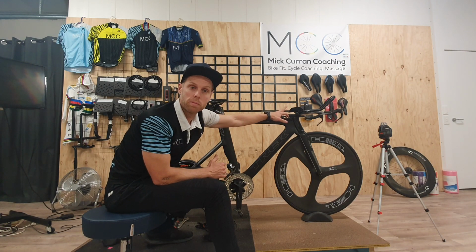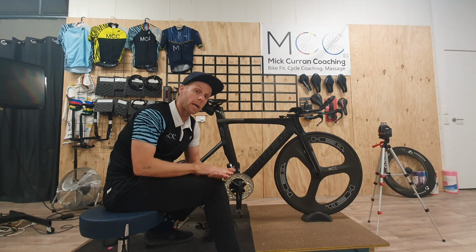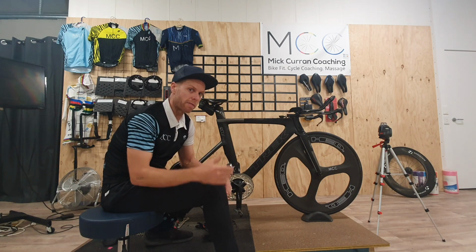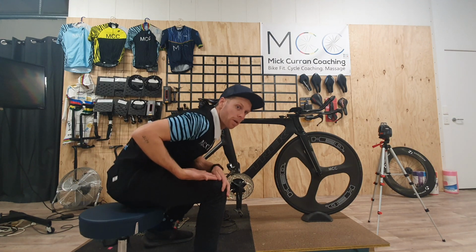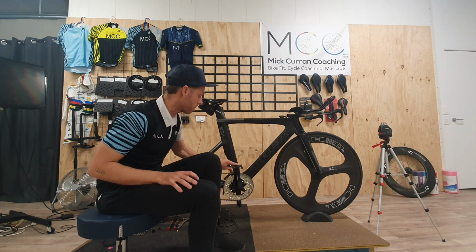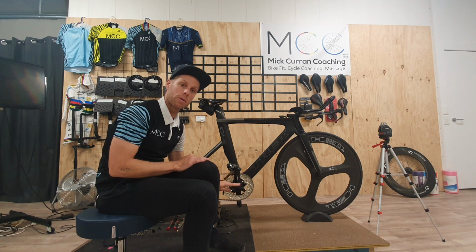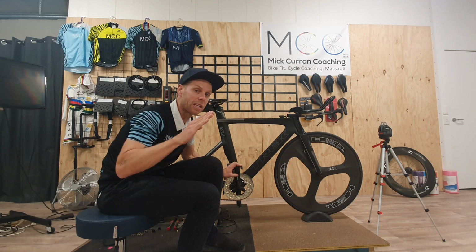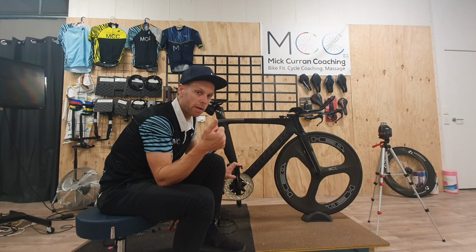So when I have arm cups on my time trial bike, I have a low front end and a really reduced torso angle, right down in the single digits of torso angle. Ultimately, why I run 165mm cranks is I don't want my knee hitting my chest every single pedal stroke, because I have a really low torso. You can imagine, when the pedal's at the top of the pedal stroke, the higher the knee in space. So a shorter crank means the lower that pedal is at the top of the pedal stroke. Therefore, the lower the knee. It doesn't hit me in the chest, allows me to get a lower front end, lower torso, more aero. That's the aero part.